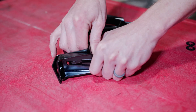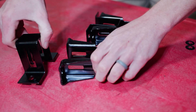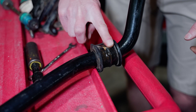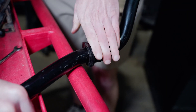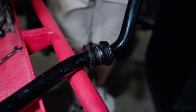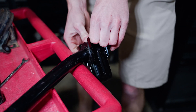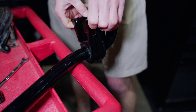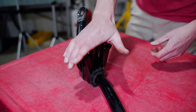Whenever both of the brackets are removed, you can begin the mock-up of the sway bar. Go ahead and separate the two sections of the provided sway bar mounts. Thoroughly lubricate the inside of the bushing and any part of the bushing that will make contact with another surface with the correct grease. Install the bushing in the correct orientation and then slide the U-shape bracket onto the bushing, then position the other section of the mount into place. Do this for the other side of the sway bar.